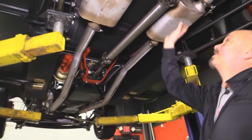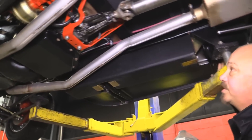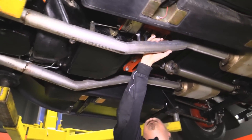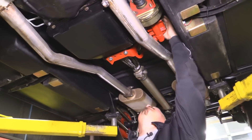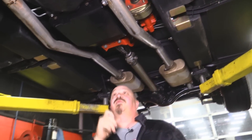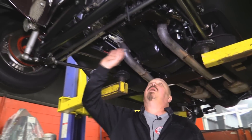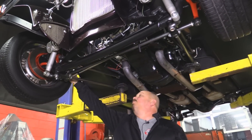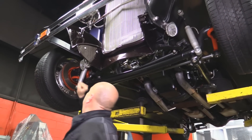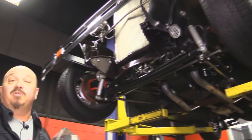Brand new exhaust, looks like a brand new driveshaft and brand new U-joints. It's got dual tanks on it. Rear fenders and running boards are steel. Turbo 350 trans. We've got a Corvette-style master cylinder — it looks like it may be accessible from the top, but it doesn't look like there's a trap door there, so you're going to have to check that with a mirror and use a little hose to fill it if needed. The torque converter's got a nice cover on it. 350 up front, rack and pinion steering, disc brakes up front, solid front axle — definitely a drop axle with a single spring pack and great looking shocks. All the paintwork looks good; this baby is well done. Sharp build.